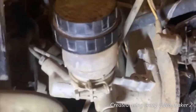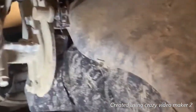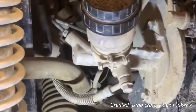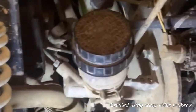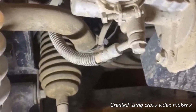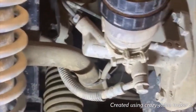If you watched my last repair video for the Rhino, you'll know that my caliper was sticking and my brakes were getting hot. It melted and busted my caliper piston — basically the seals out of it. I'd already replaced the line and thought it was just a caliper, but it still does it. I've read a couple places saying that the master cylinder would cause this, that you'd get crud in it and could take it apart and clean it. So I'm going to try and do that today.